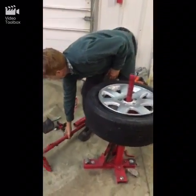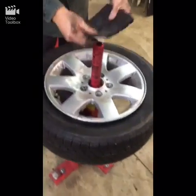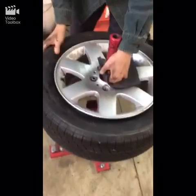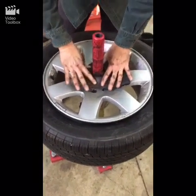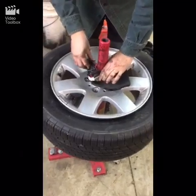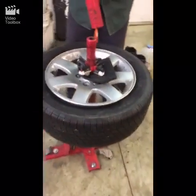The first tip is that if you cut a piece off an old tire, it helps protect the rim. Push this down before you put your rim stop on. By the way, a better option than the Harbor Freight tool is just an old 3/8 socket wrench — drop that in and it locks into the lug nut hole a little bit better than their tool. So we have this nice thick piece of rubber that goes on the spider here that locks it down, so when you rotate it on, it's not going to touch the rim and has a lot of cushion so it won't dent the rim.